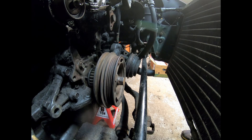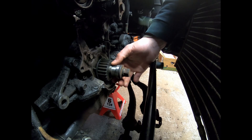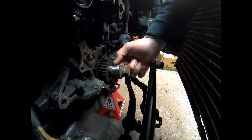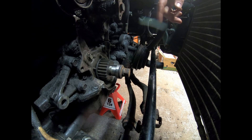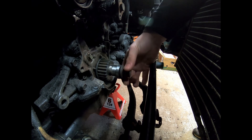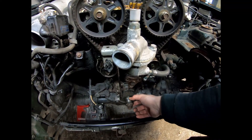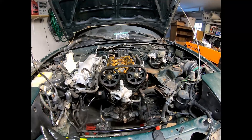I'm going to pull it back apart to show you the difference in shaft length. Here is the saver on there without the crank pulley — you can see it like triples the amount of surface area that the keyway has to support the harmonic balancer. It's a really simple idea but it works great. From here I'm going to throw the timing belt back together, put this on there, run it with some blue Loctite, and torque it down with a torque wrench.